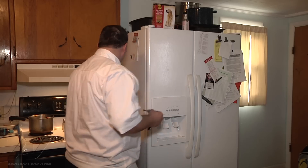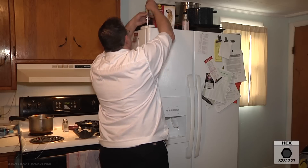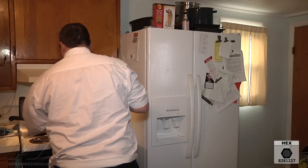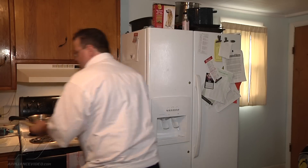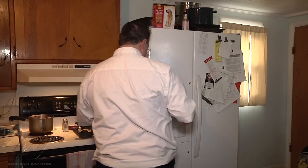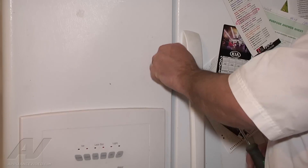First, I'm going to remove the top hinge cover with a 5/16 screw. Then I'm going to remove the handle — all you do is pull up. The new door does not come with the mounting tabs, so I've got to take them off and transfer them.